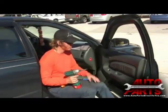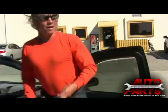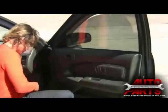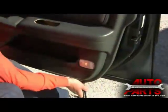Buying your own part and saving your own money is a great thing. You may encounter some covers over top of screws — remove anything on the door that might have a screw behind it, then remove the screws. Looking around the door for anything else that might attach the panel. Now we're going to need a little prying to release the door. Put a screwdriver in there and just pry away. The door panel comes up — there's a lip across the glass, and all you have to do is pull up.